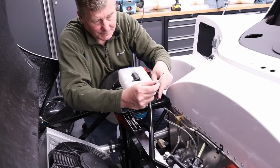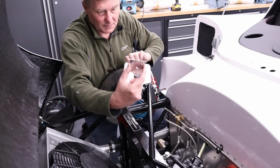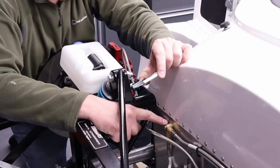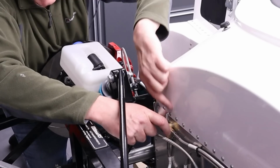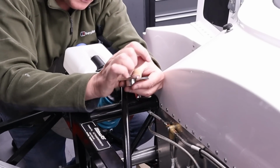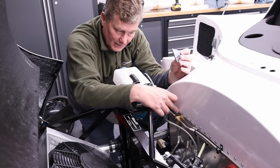which is here. Now, this bracket goes on the back of, if you can imagine here, it slots onto there. And the position of this, the bottom hole goes on this set screw here that holds this T-junction on. And that is pre-drilled in the aluminium panel, so you know that's going to be in exactly the right place. Now clearly there's a space behind here, and Ultima kindly provide this turned spacer. And that sits behind that panel, and they provide, whoops, this M, I think it's an M6 set screw that goes through here, and also a riv nut that goes into here.